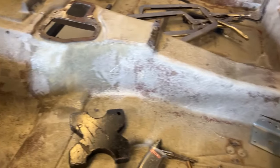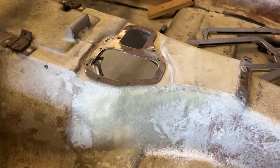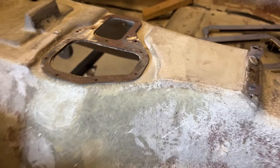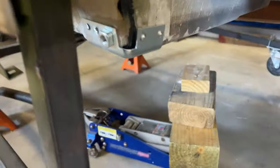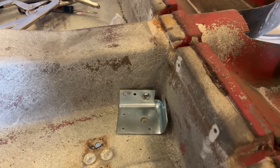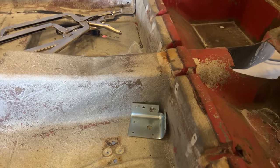Finished up for this week. Not going to be a lot of content, but it should be a halfway decent video. You can see here where I patched the tunnel - it was pretty soft right around here from probably oil saturation, so I cut that out, rebuilt that, patched the floor. A couple of real small cracks. From the previous videos, I worked on these corner brackets for the seat belt fasteners. I got both driver's side and passenger's side in, all riveted in. Didn't get these in because my arms are long, but they're not that long - I can't reach that and rivet it at the same time, so I'll have to get one of my buddies to come over and help me.